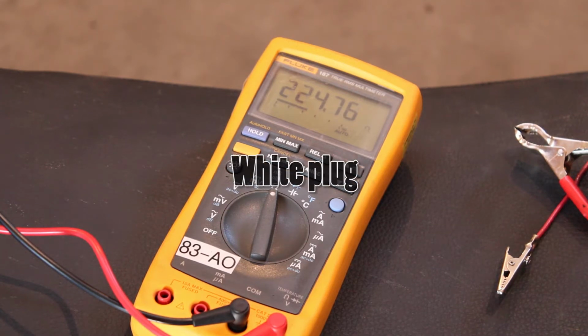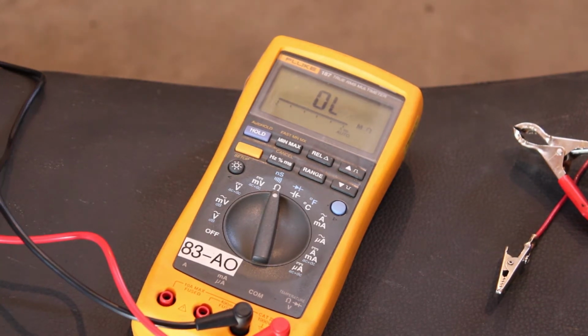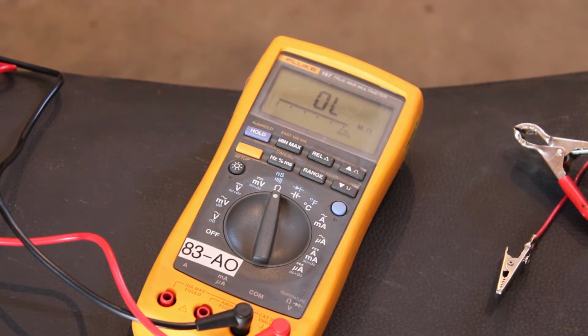224 ohms. Now, you know, I really wish I could find a better wiring diagram. I might just have to suck it up and buy a manual for this thing. But there doesn't seem to be anything super wrong other than that voltage seems to drop out when you turn the engine over faster, which doesn't make a whole lot of sense to me. That sort of seems like it's indicative of an issue with the coil on the stator, but if you check the resistance of it, you get a value back, which should indicate that it's good, more or less, unless it's the rotational force that causes the short, or the open, I guess.